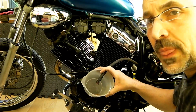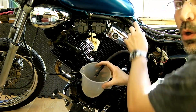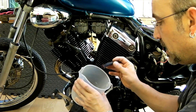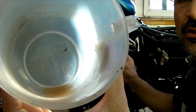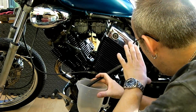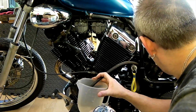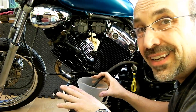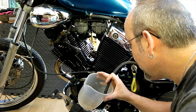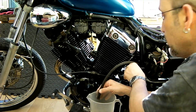I've pulled the pipe off and I'm holding it down into the jug to control where it's pouring. Initial appearances are not good - that's pretty manky looking fuel in there, suggesting some crud in the fuel tank. It's really looking like the fuel tank is going to need whipping off and giving a good clean out. We'll see what it looks like when I start pumping it out a bit more.